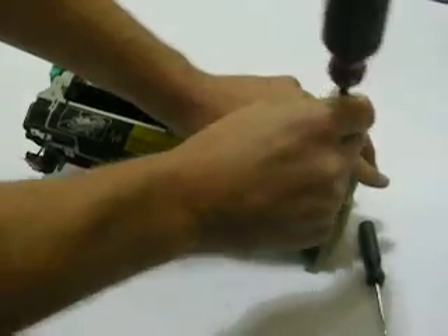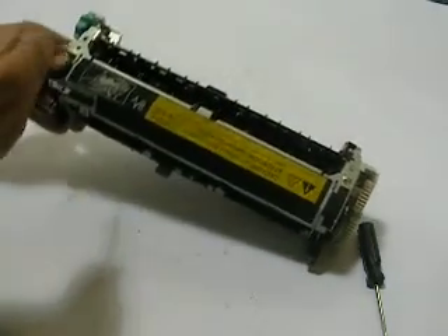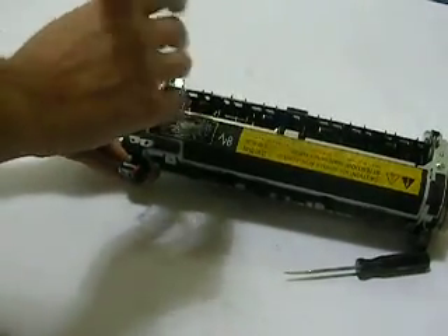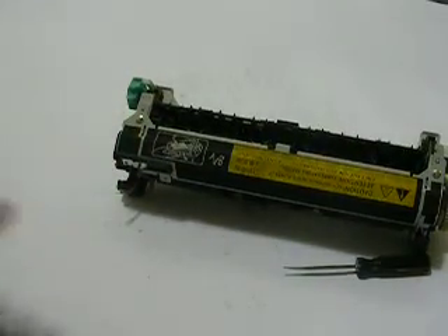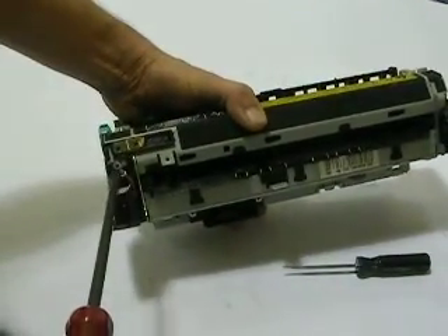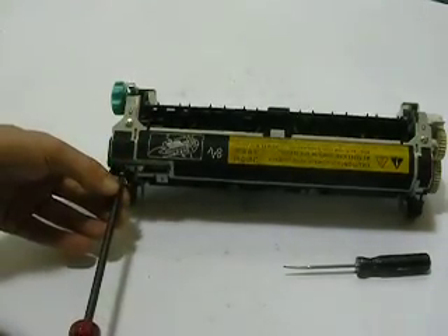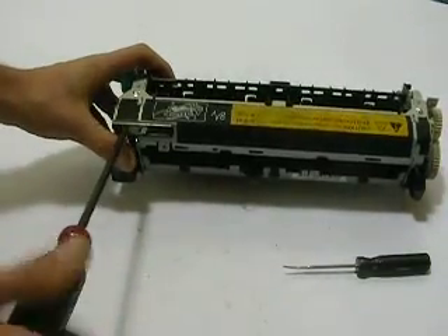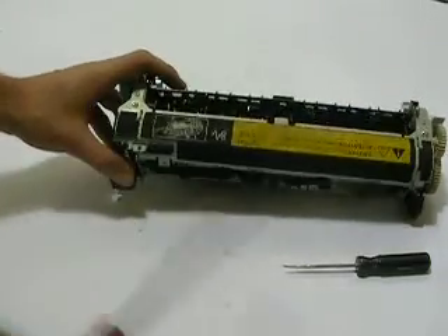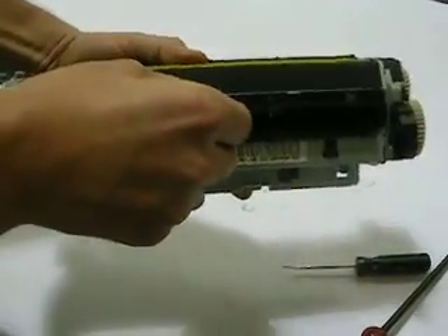So you can see, this is a real easy repair on a fuser that's quite expensive. We've got one screw in — let's put the opposing screw in. I try to work just like you; I don't try to manipulate the video — it is what it is, and so sometimes you'll see me struggle. Let's put in the red wiring harness — this is a grounding contact, that was part of that side of the fuser sleeve that had that larger cutout in it, for that contact point, just like a little wire brush that kind of hits it. Let's reinstall the little black plate — real simple, hole lines up.